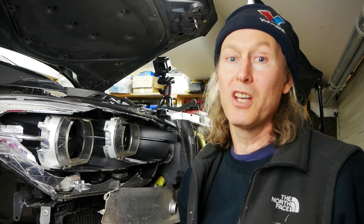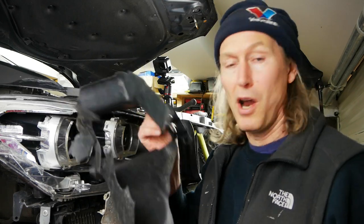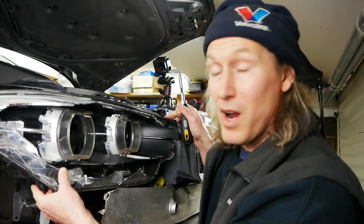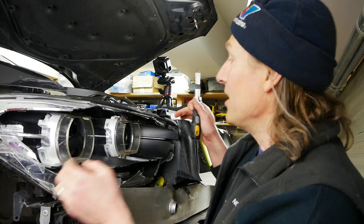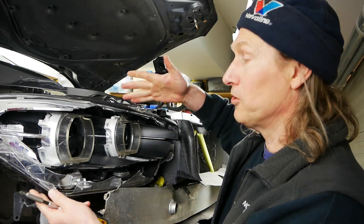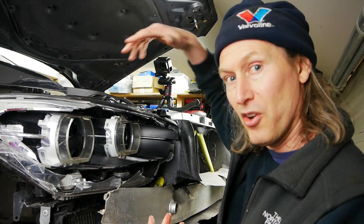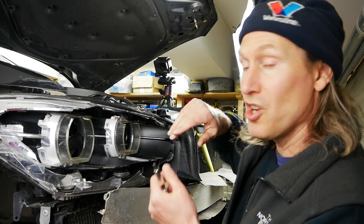The not very sexy part of accident damaged car repair is identifying all these little pieces - because it's nice going and getting a nice new bumper or bonnet or wing and bolting it on, but this is the time-consuming bit: all the little brackets and plastic pieces behind. We'll come back to that in a minute, but I'm going to get this headlight out now because we can definitely see this one's shot. Ordinarily I'd be consulting my E-manual to find all the anchoring points, but most of them are just smashed away - it's hanging on by a thread here, just one bolt at the top remaining. Then we'll be able to pull that out, and there'll be some electrical plugs at the back, but since it's coming out anyway it'll be a lot easier to reach in there with it detached.